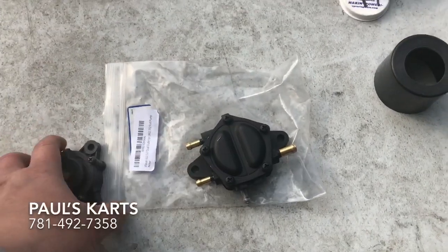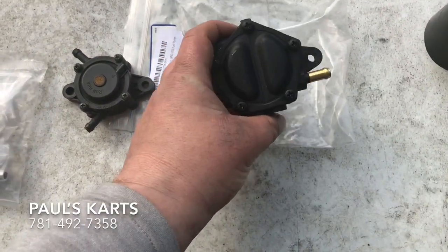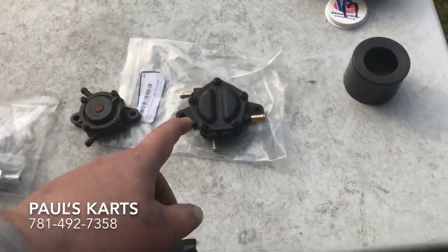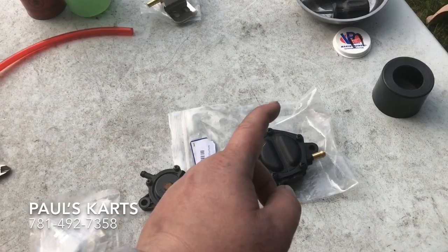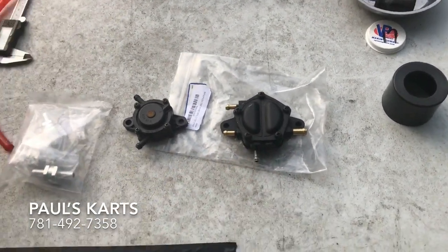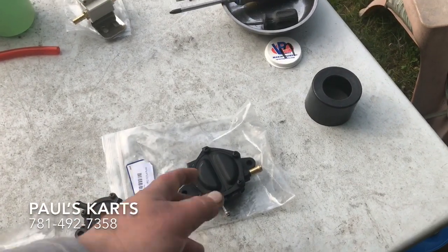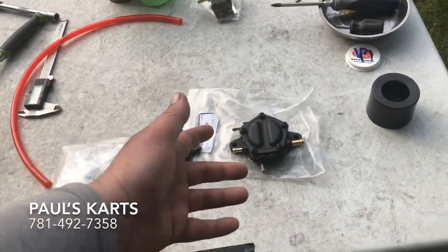This big Mikuni pump — this is like 75 liters per hour — is double those big metal circle Mikuni pumps, like the big powerful ones for two-stroke Rotax shifter carts. This is double those. The guy says this will power a 1600cc two-stroke snowmobile Rotax engine, jet ski engine. So this better be able to do methanol on a 400cc — we'll see. Usually you're around triple the amount of fuel for methanol. So 400cc tripled is around 1200-1500cc, and he says this will do 1200 to 1600cc sleds. So it should be just about enough to do it.